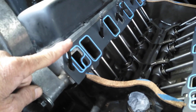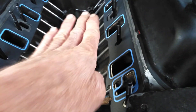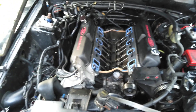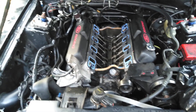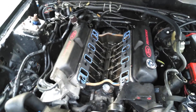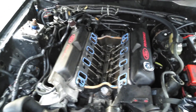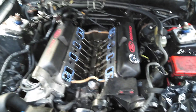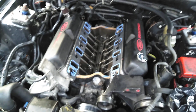What I'm gonna try to do to fix this problem and get the intake going on is I'm gonna remove the studs on this side totally, and I'm gonna try just dropping it on with the studs on this side and see what happens. Now for this particular motor — this is the Ford Race and SVO 351, the D351FT, and it's the M-6007-D351FT — and these are GT40 aluminum heads.